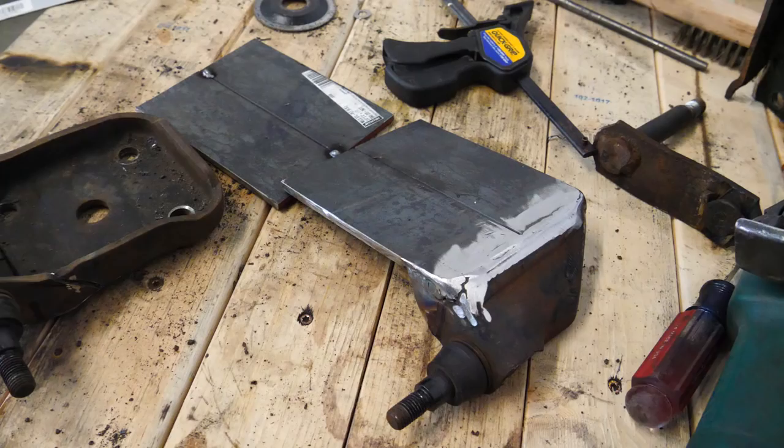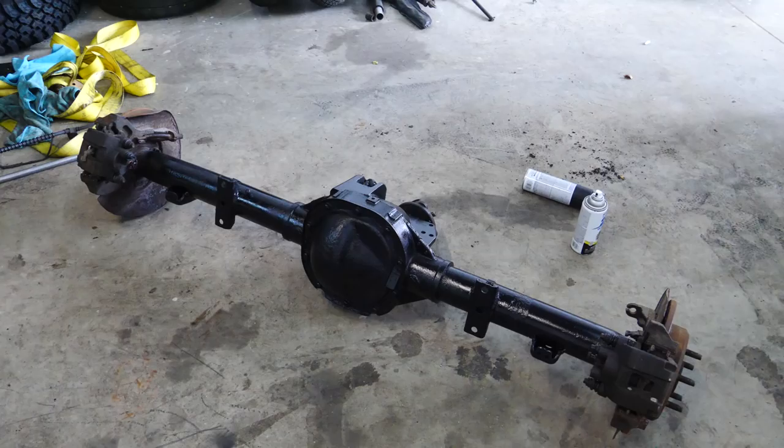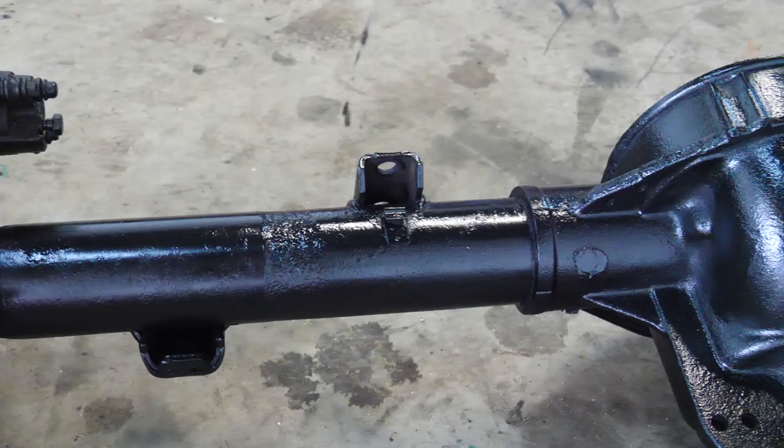Besides the angle grinder cutting blade incident, I'm really, really happy with the way everything went. I successfully managed to cut off the leaf spring mounts and move them over on the axle. I managed to pretty much make some new mounts in the truck for the U-bolts. The axle looks really awesome. It's nice and clean. It's painted, so that's awesome. Another thing we're gonna do in the next video is mount the sway bar, so we have swayness.